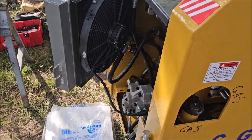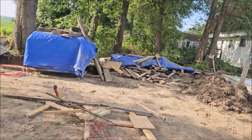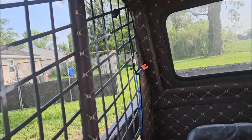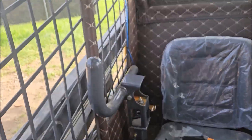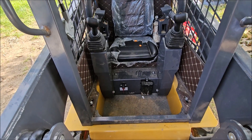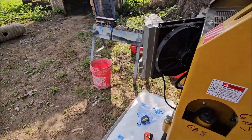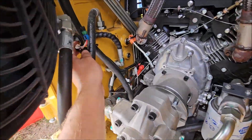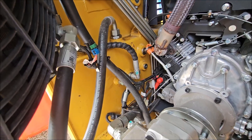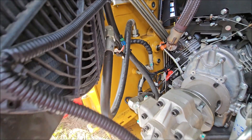There's no more thermocouple, no more switch — the switch up here in the cab doesn't even turn the fan on anymore. I just used that extra wire that was hanging down — the one meant for an optional cab fan — swapped the fuses, and made it so the fan runs all the time. Also, a tip: the manual and all the wires on these machines are labeled in Chinese. Just download Google Lens, hold your phone up to the labels, and it'll translate them right there. That's how I figured out what all these little wires went to.